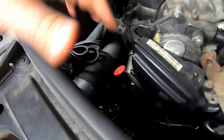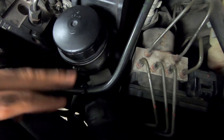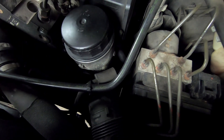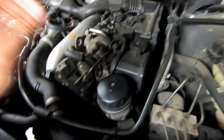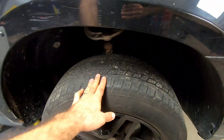The whole thing is going to come out together in one piece, so I'm not going to bother taking anything off at the top. We're going to have to disconnect the harness going on the left side of the intercooler and radiator piping. The AC is on this side with the hydraulic pump. I'm going to try to keep the AC on so I don't have to discharge it - basically unhook the compressor from the motor so the compressor can stay with the car. On the bottom, I'll have to disconnect the drive shaft and everything connected to the transmission.